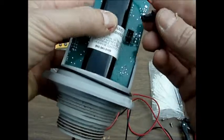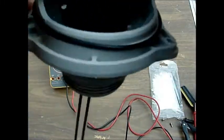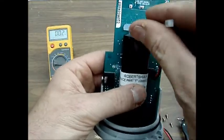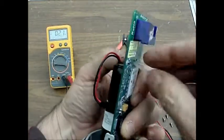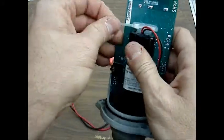Take the connector so that the tabs point inside towards the battery. Insert the tabs all the way until it won't go any further, and it holds on its own. Then take the provided tie wrap, insert one end through the hole provided, bring the other end around through the other hole, slide that up and through, insert it through the tie wrap's other end, and cinch it tight.